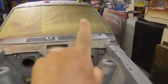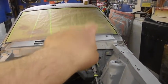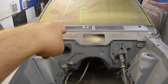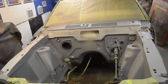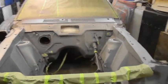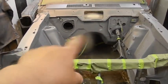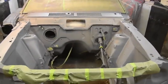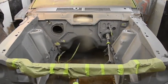Technically, the rubber line is on this side on the Ford Explorer, okay, to the rear, and then it does all its crap. My car, it's on this side. Now, you can switch the brake hoses and achieve the same thing on the rear, which is probably what I'm going to do. It really doesn't matter. It doesn't pay for me to have the brake line come over there and then come back over and enter the back of the car. And I don't like to have brake lines cross over anywhere near a drive shaft, if I can help it.